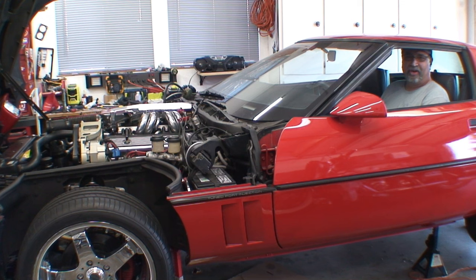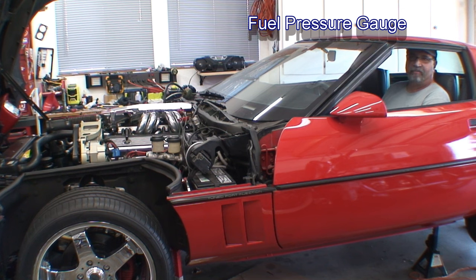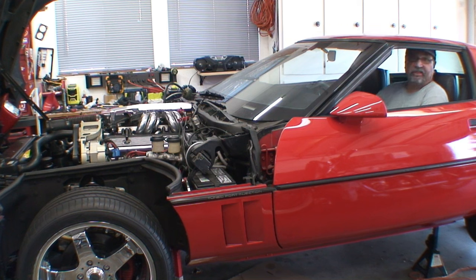We had a couple of issues going on — that's why it didn't want to stay running. One of them was the fuel pressure regulator: the vacuum line that goes into it had the brass fitting pop off. And then I blew a fuse for the fuel pump. Tracking down those two issues pretty much took care of it. Right now it's sitting at 40 psi for fuel pressure, but I can't really adjust it further until I get the fuel pressure regulator off, because it's in the way of adjustment. But she fires up.